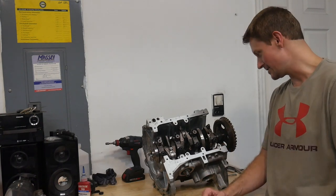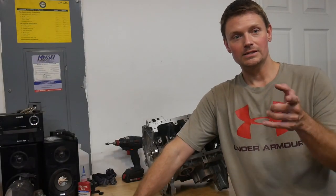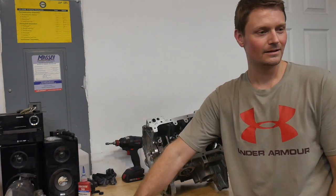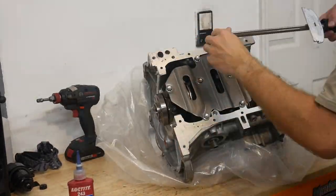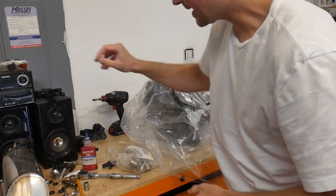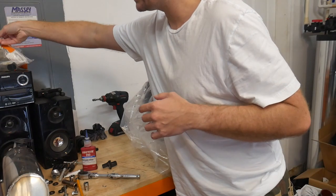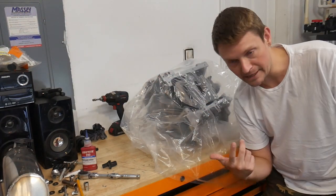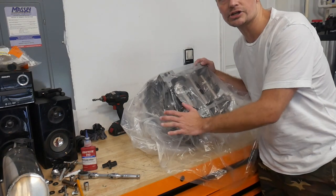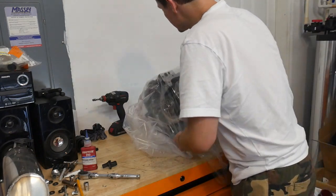For me, I'm trying to keep 900 to 1000 pounds in the dune buggy, so it makes a little bit more sense to go into this kind of extreme build. Now we know what it takes to build a 300-500 horsepower 3A92. I still have to build the rest of the engine, so we're going to build this engine together really fast because this whole thing has to go back together and I've got about a week to get ready for Durham Town. These are the little shimless bucket spacers that go into the head. I can't continue until I get the head buttoned up because the head needs to go on so I can start doing the timing chain.